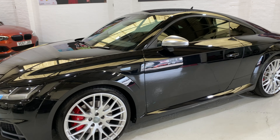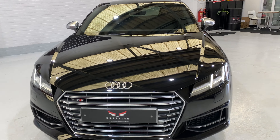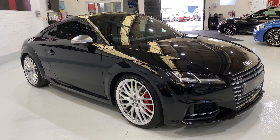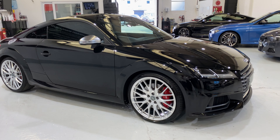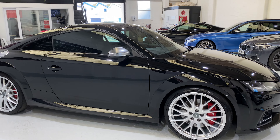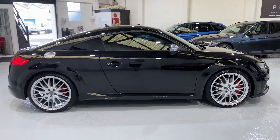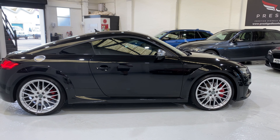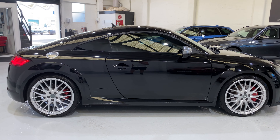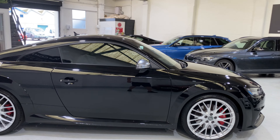So the car gets a thorough clean and the finish is really beautiful, as you can see. We haven't done it yet, but this car will go around to the mechanics for a check over. I think we're probably going to change the rear discs and pads. The discs haven't got any lipping on them, but just from lack of use they've got quite a lot of surface rust on the edges, so we're going to change them and make it all look nice — because the car deserves to look nice. It's a stunning looking car.